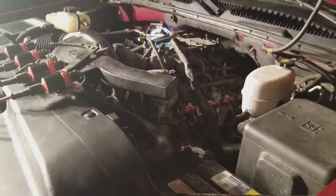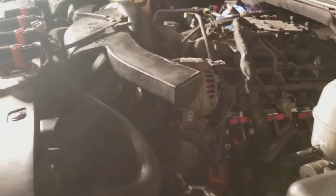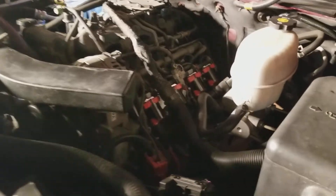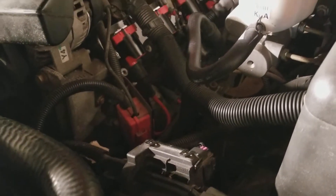There's more to come with the Escalade upgrade. I plan on doing a cold air K&N because this truck has electric fans and there's tons of room. On the ESV you couldn't put a K&N because there's no room between the shroud and the front of the throttle body. I'm also possibly doing some headers. I didn't change the plugs yet, but I did buy NGK iridium plugs.